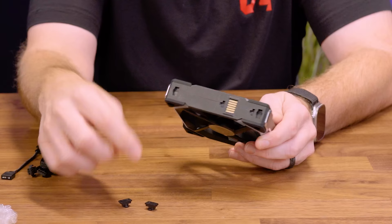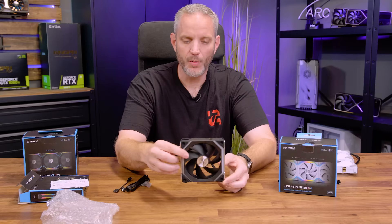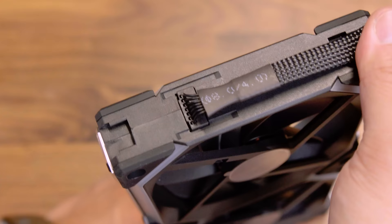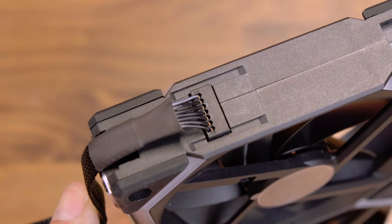Just like the V1s, those slides do twist off. But looking at the new cable, it's got a hybrid system where the contact push pins are still there, but it's thin enough that it won't interfere with radiator fittings. The flat tab piece pushes down the contact pins so they're insulated and isolated from anything nearby — that's used with the second cable which comes in the three-pack for daisy-chaining via wire to another fan.